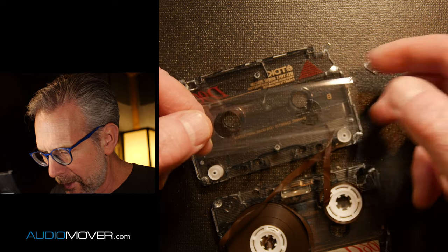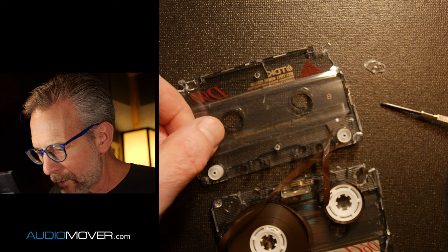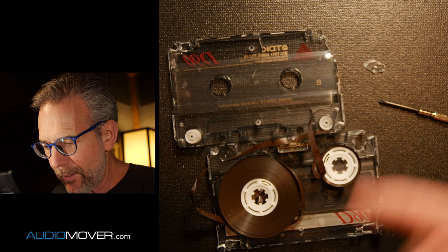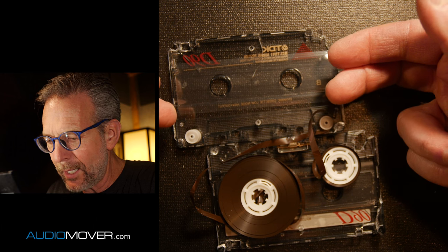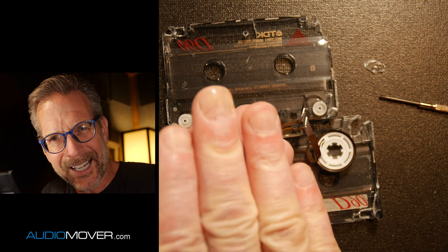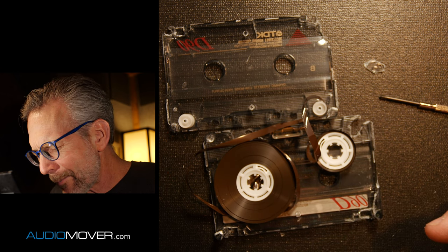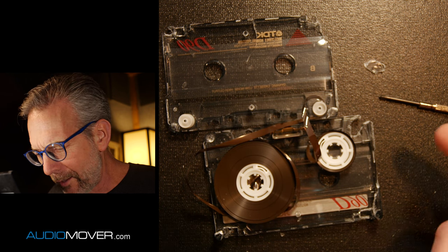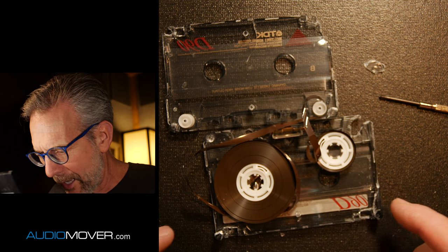Now, if you see right there, this little thing — that's kind of like a gasket. See those ridges? The purpose of those ridges is to keep what happened on this tape from happening. They poke up just a little bit — they're embossed or beveled just a tiny bit — and that's supposed to happen on both sides of the tape, putting just a tiny little bit of flexible pressure to keep the tape wound correctly. But sometimes if it gets pulled really tight, it'll just yank itself off the spool and then just kind of jam down and make a mess.